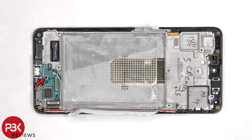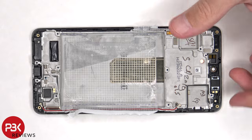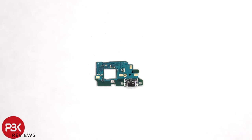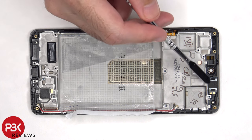There's a single Phillips screw holding down the subboard. Looking at the subboard, there's a rubber gasket around the screen connector, and the charger port is located over here. The primary microphone is located on the other side. The X-axis linear haptic motor or the vibrator motor is located over here on the bottom corner, and it's held down with some adhesive. The flex cable for the volume keys is located on this side, which is also held down with some adhesive, and the same goes for the earpiece speaker, which is located on top.